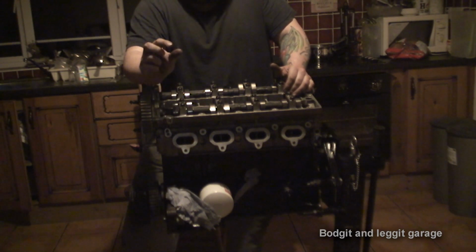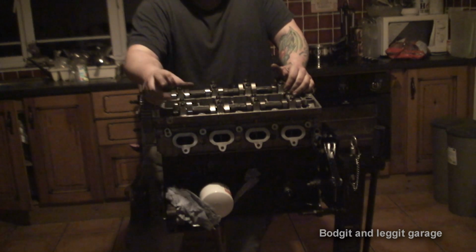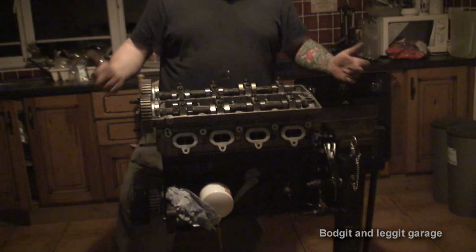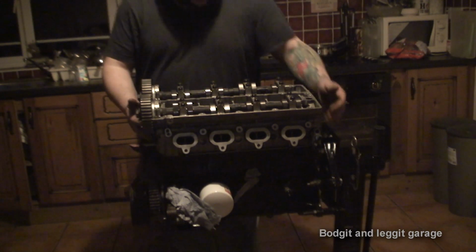Squeeze gap. So if we've squeezed that plasticine by over 2 mil, we're in trouble. If we squeeze it by a mil, we're okay. We'll measure it afterwards. But all I'm really hoping for now is that the plasticine hasn't come off completely and, you know, I'm not going to get a full test. So I'm going to take off the head.